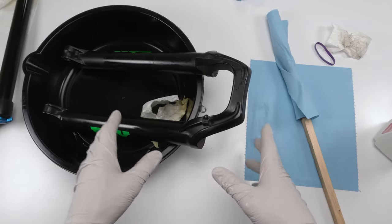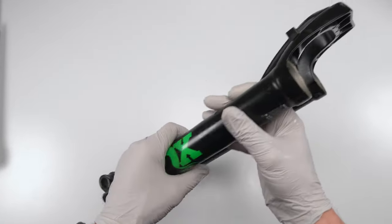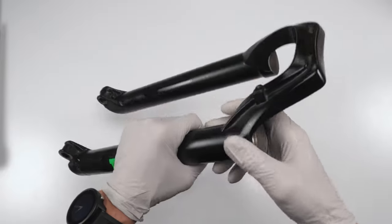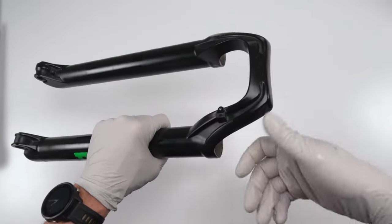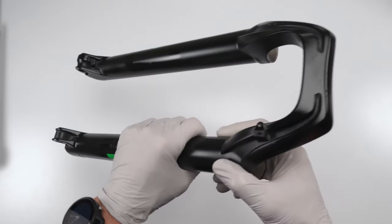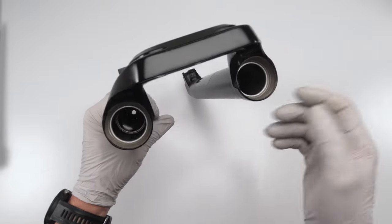All right, I'm gonna finish this up so I don't have to tape it and waste more time over here, okay? So we cleaned the lowers, right? Again, recap. We sprayed it down with alcohol, shake it around, empty it, take paper towel with a dowel, rubber band, mop it all up in there real good, do it once again, empty it out, mop it up real good, and you are done once you do both sides.